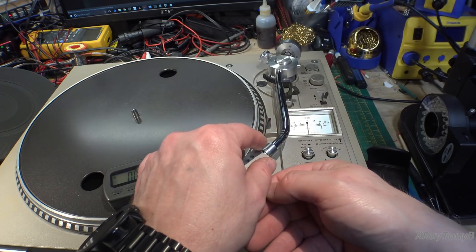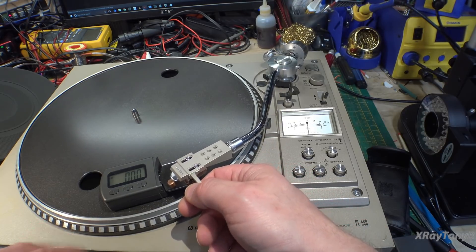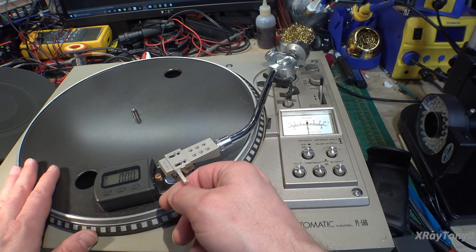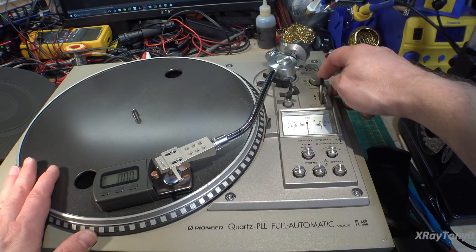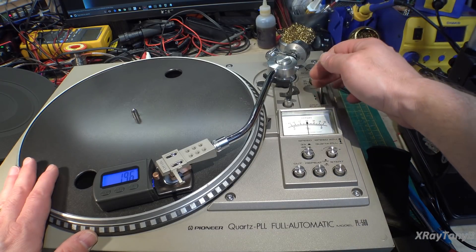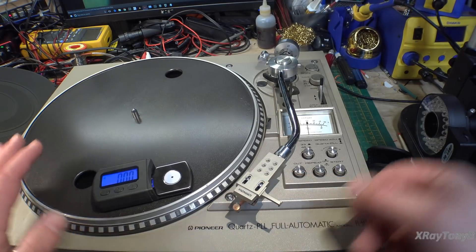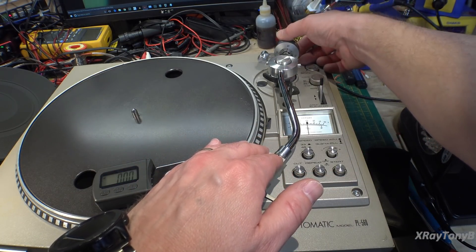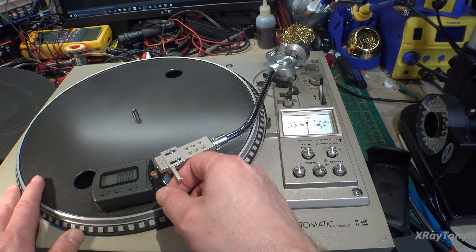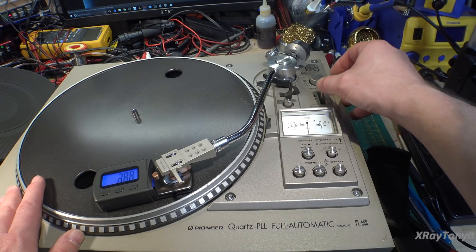Now that that's set, we're going to move this outer ring until it's just on zero, and then we're going to move this overall weight up to two grams. We're going to go right about on two grams, turn this on, and very gently take this out. I have the platter mat removed. We're going to try to do this around the camera without hurting anything. I'm going to lift it up, get this lined up, and set it down. 1.98 grams - that is pretty darn close. I don't know if we're going to be able to get it any closer. I'm just going to barely touch it. There it is - so that's good, we're going to leave that right there and do our next alignment.